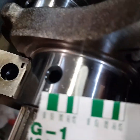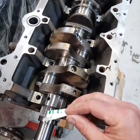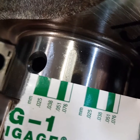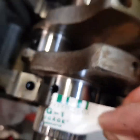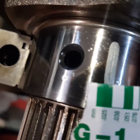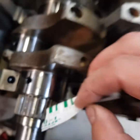So on mine, let's have a look — 0.38, so almost 0.4. I cleaned the caps up a little bit, so I should be at the lower part going down to 0.25, right in between the two. I'm hoping to get a little bit less clearance. We need to get a little bit bigger there — 0.25 or 0.3, that's what I'm hoping for.